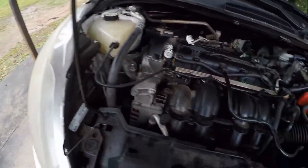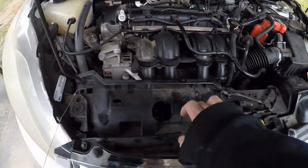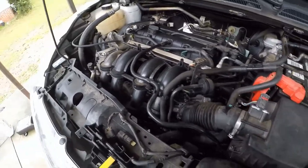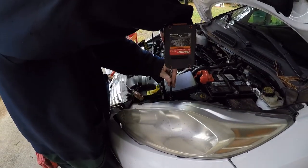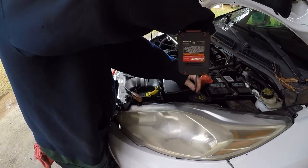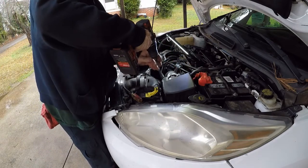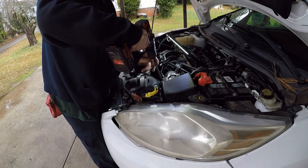So you're gonna take all this off right here in the front, just the front clip. You gotta have a bunch of push plastic things. This is gonna come off, and I'm gonna pull this air cleaner off first, and then we'll start getting the thing. That's a T25. Take off this breather here. Just undo your mass airflow sensor. Try to undo your hoses, just to get everything out of your way that you can.